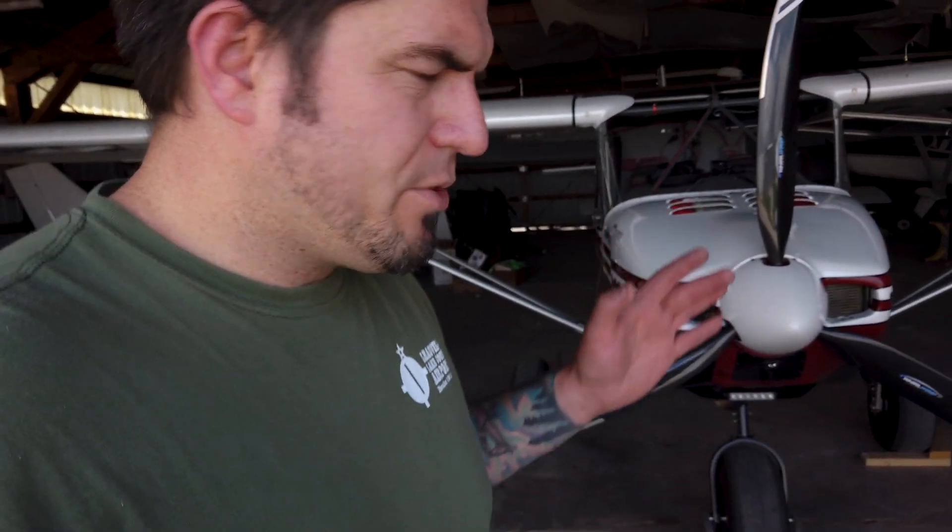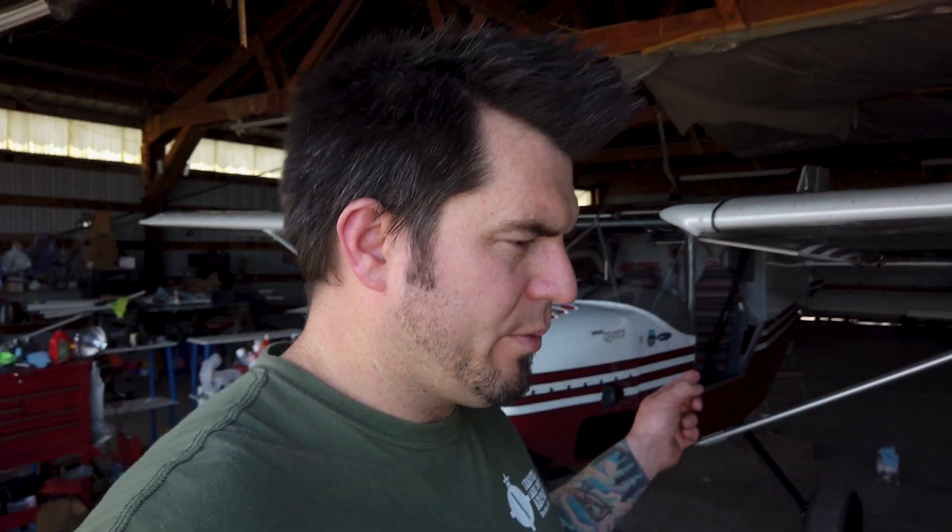Before I end this video — I'm not an instructor, and I'm definitely not telling other people to go out and actually pull the power completely off, shut down the motor to do a simulated engine out, because that's actually not simulated — that is an engine out. If it's something you're comfortable with, fine; make sure you've got altitude, make sure you've got the field made. I've had this thing quit twice due to vapor lock — once in a field I'd never been to before, and once on my home runway, which is pretty short. About 10 feet in the air it quit right after takeoff, just boom, dead. In that situation you don't have time to really panic — it's kind of like muscle memory, you just go back into landing mode and set it down.